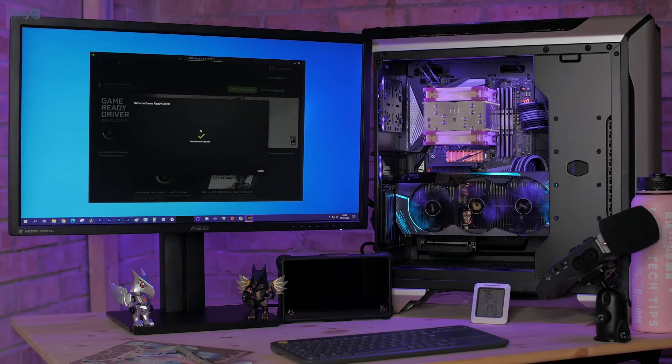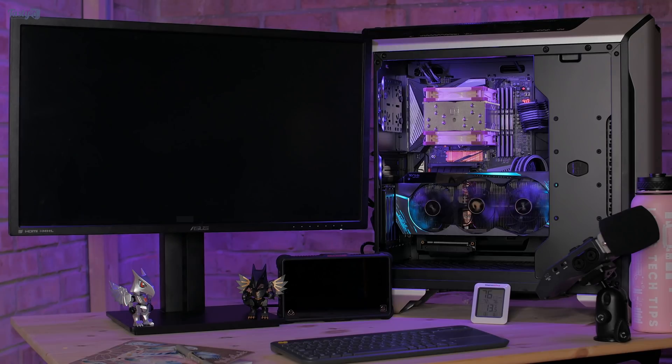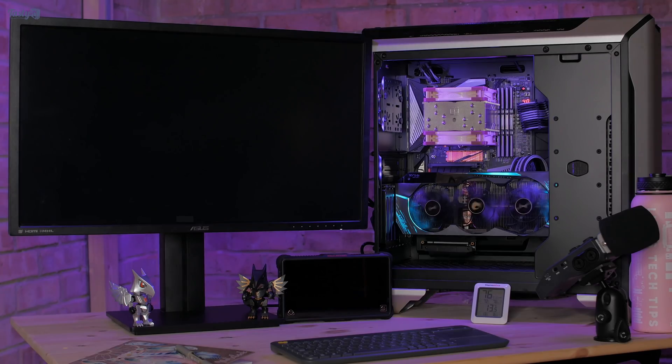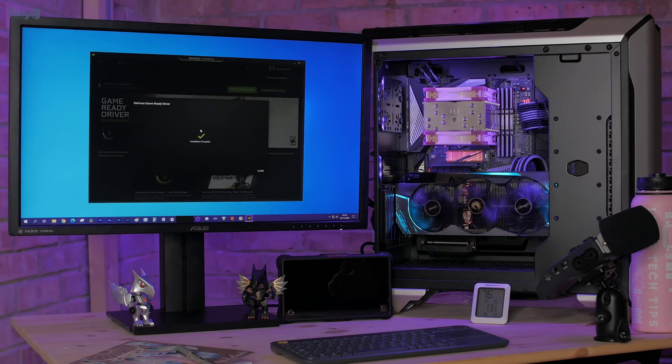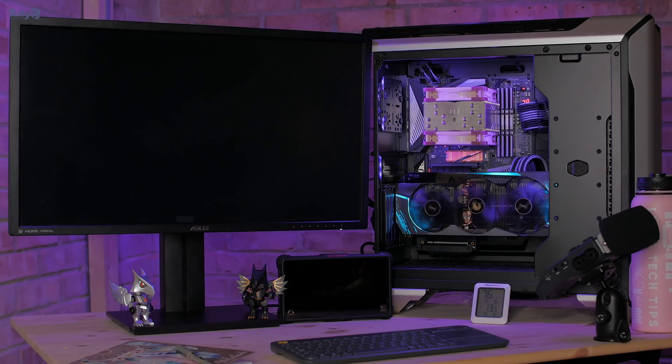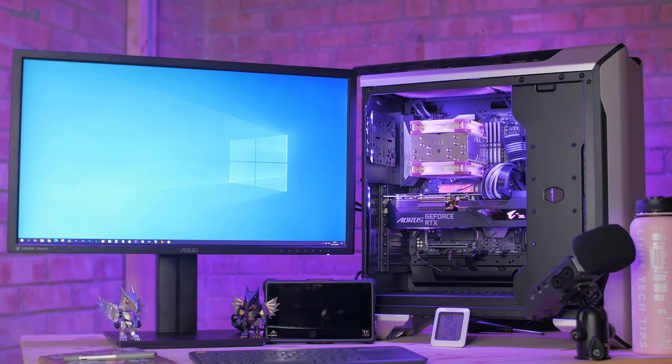For the next bit of the video I recorded live audio from within the garage, but I then accidentally deleted it, so you get a voiceover instead. I'd set everything up and was ready to go, but I ran into an issue where the driver wouldn't stay installed and the screen just kept turning off. Looking back, it was probably just because the 3080 is a PCIe 4.0 card, but at the time I just ended up reinstalling the GPU non-vertically and that fixed the issue.